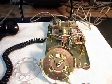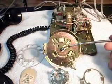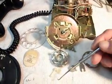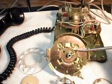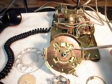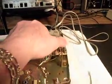Another thing I noticed was the network was loose in here, so someone's probably been into the telephone trying to find out what was going on. We're going to reinstall a black modular line cord on this telephone and repair this rotary. If we can't repair it right away, we'll replace it and repair it down the line, since we need to locate the nylon stop and fix the tab that keeps the rotary from going too far backwards when it returns. It may be simpler to just replace the rotary assembly.